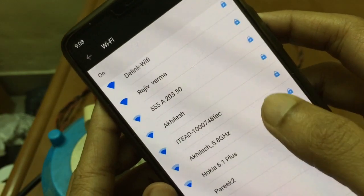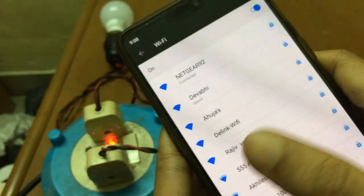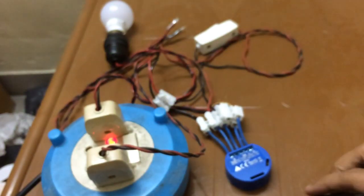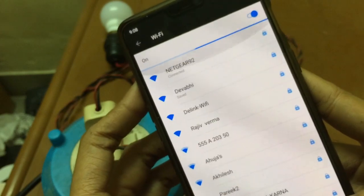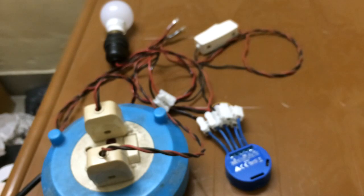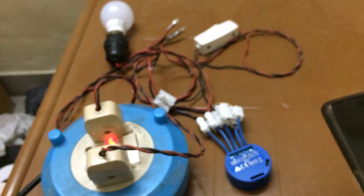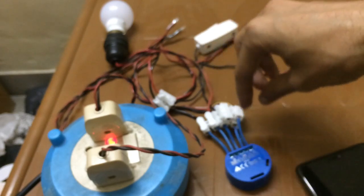This can happen due to network issues. If the process does not complete in one go, you need to reset the device. Since it stopped midway, no Shelly appears in the device list. To reset, turn the device off, wait a few seconds, turn it back on, wait five to seven seconds, then toggle the switch connected to SW five times.